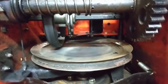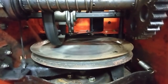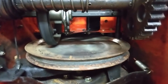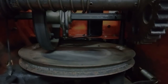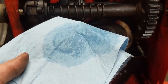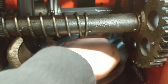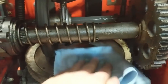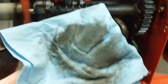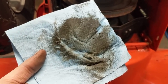If your machine is older and you've done a friction wheel replacement already and there's quite a bit of rubber built up on your friction disc, you can use a scotch pad and go in there to rough up and clean the surface — get all the rubber and any chunks off. Then use your oil and grease remover and it should be ready to go. If you're having a hard time reaching the back of that disc, just come up to your pull start, throttle the engine down, give it a little rotation, and that will allow you to access the whole disc. Then take a clean shop towel with some grease remover and wipe it all down.